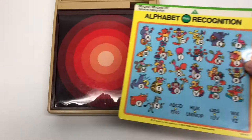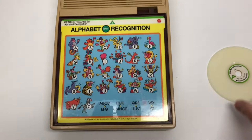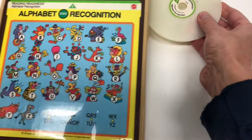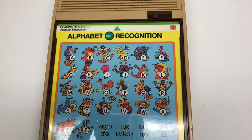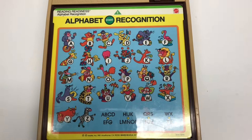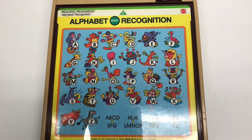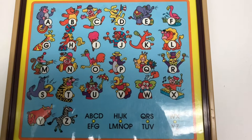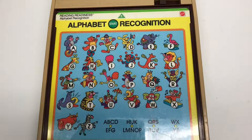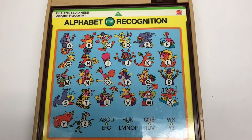What you do is take the overlay, slide it onto the unit, then put the disc in. If it's working right - which it is now because I've repaired it - it's going to start. Slide it in and press the green start button. You should always get that welcome message; if you don't, or if it says something else, that's an indication something's wrong. The pauses you notice are because it's changing to a different part of the record.